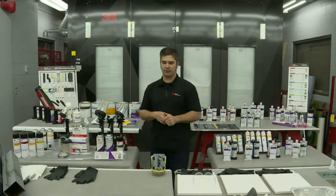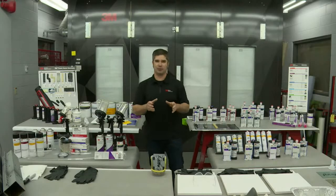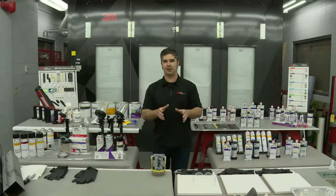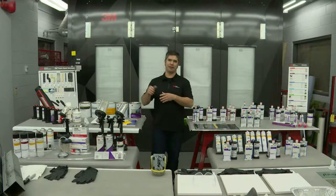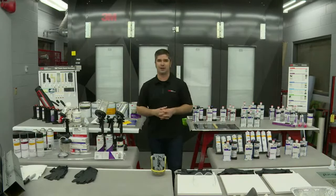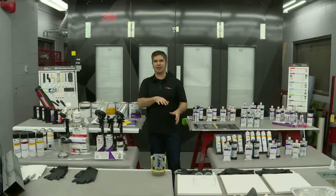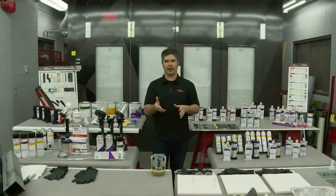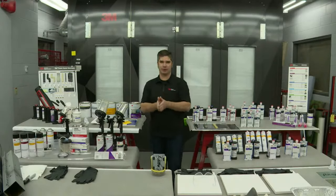I do want to mention that when we're talking about corrosion protection and preventing corrosion, I saw an image sent by one of our sales reps just the other day where they did body work on a vehicle. They wrapped it in plastic. They pulled it outside, and it was raining like it is here today, and I'm like, it is down there in Arkansas with you guys. And really, when you wrap that panel in plastic, you're creating a greenhouse effect underneath that plastic. And so you're getting condensation moisture that's now being trapped against that metal surface, even if you're using crash wrap.